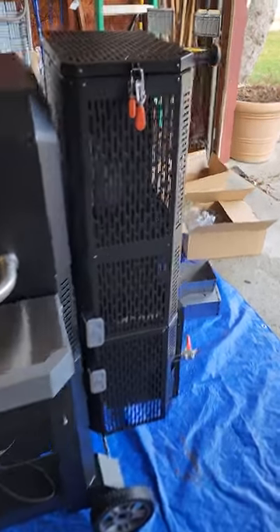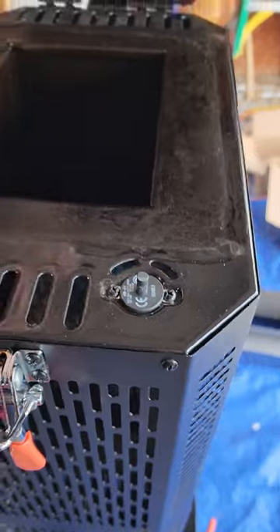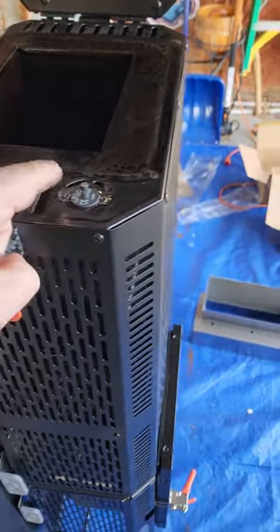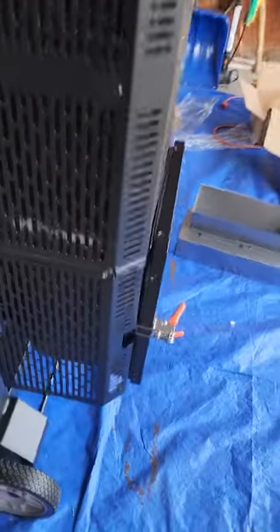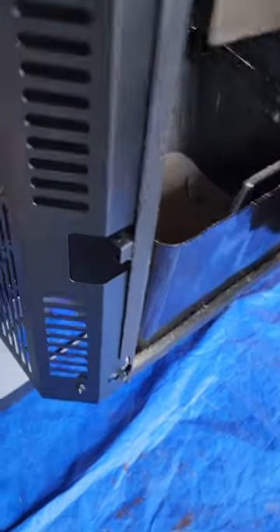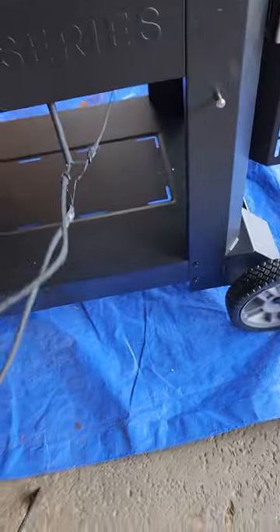While I was setting it up, I went ahead and disconnected the sensor on the hopper lid. I pulled the two screws out here, lifted it up, disconnected it, and pulled the wire out. The other sensor is down by the ash bin — you can just reach up underneath and disconnect it, then pull those two wires out and they come out here like so.